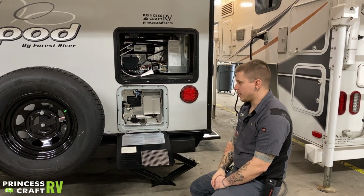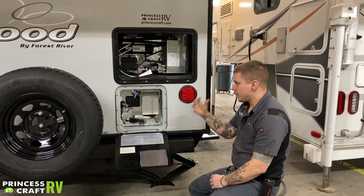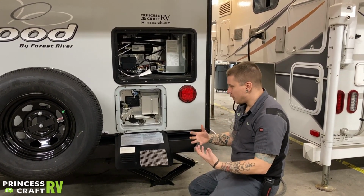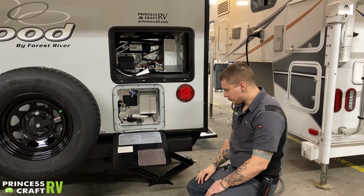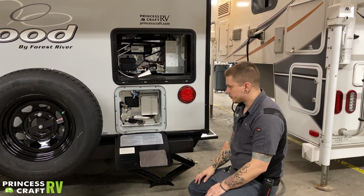before you see it at the fixture. So initially you're going to turn on that fixture. That flow is going to be very bubbly, very spitty, very interrupted. As that flow normalizes, generally that is the indicator that you have pumped 6 gallons of water into the water heater and you are clear for takeoff, ready to light.